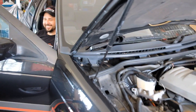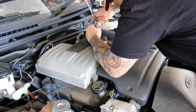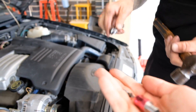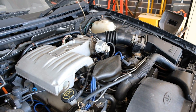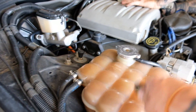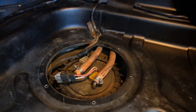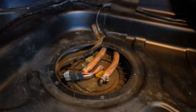So who wants a Charade? Alright, manifold — engine cover's coming off. Wow, look at it. Just look at it. Freshie. So we're going to remove the alternator and change the regulator because it's doing funny things. We've got a new overflow bottle on order just to pretty it up a little. And then we're going to work our way to the back and pull the pump out and just inspect it because we don't want something to happen to it. Looks like it's been off before because it's marked — nine times out of ten it's probably going to be new under there.